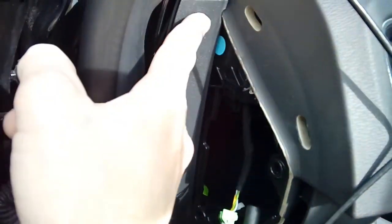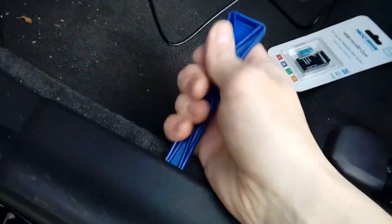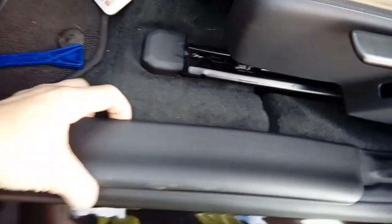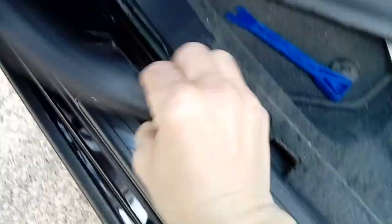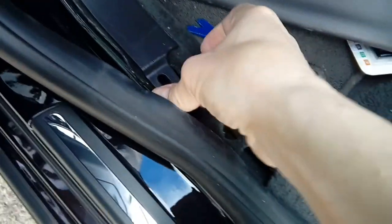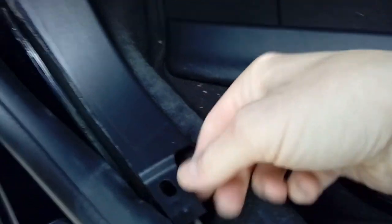This is your airbag on/off switch connector — leave that on, do not unplug. This piece of trim pops off so we can put the cable behind it. To pop this piece off, we have to come down to the sill trim — it's on a little clip, sometimes you can get your fingers under it, sometimes it needs a wiggle. When you get it off, note it's on a slide hook at one end so don't pull straight up. Pop that out of the way, giving access to the end panel. It's on clips — there and there — so pull up. Your car, depending on left or right hand drive, may have a bonnet release requiring a TX20 driver to remove.